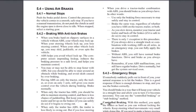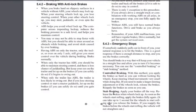There are two types of braking: control braking and stab braking. We do control braking. The reason we don't do stab braking is that ABS won't allow it. It's not that stab braking is bad — it's just that all trucks after March 1st, 1997 are required to have ABS systems. So before that you could do stab braking, but after ABS was put in the trucks we can't do it anymore. So we do control braking.